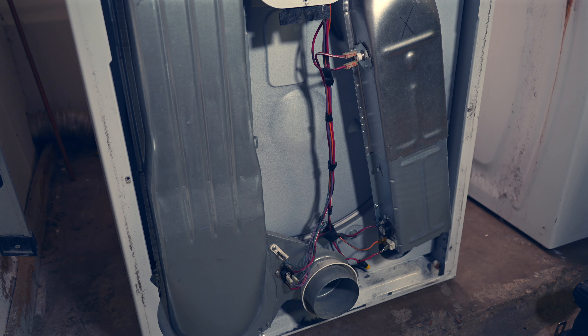Here's what the back of our dryer looks like. There are a few important components back here that we're going to check - if one of these has failed, that's probably why we're not getting heat. Right here is the thermal fuse. Right below it is the cycling thermostat. Right up here you have your high limit cutoff. Right here you have your thermostat. And just below that, inside this encasement, you have your heating element. If any of these items has failed, that's probably why you're not getting heat. Some of these parts were designed to fail to protect your dryer, your home, and everything - if it overheats, the part will fail and keep it from catching fire. I'm going to post a picture of all these components online so you have a better reference.